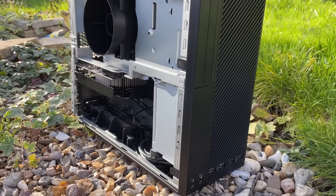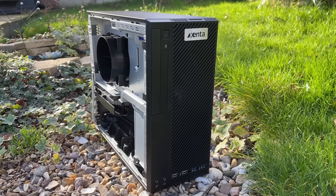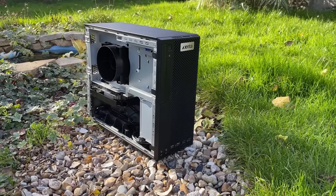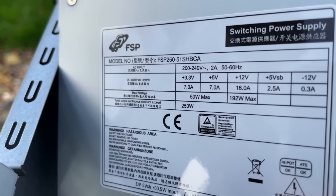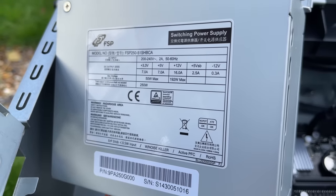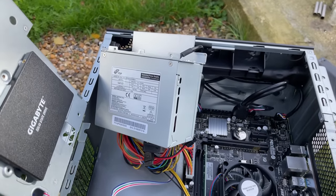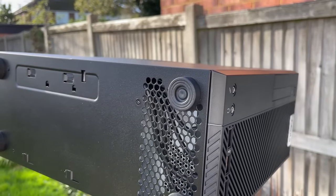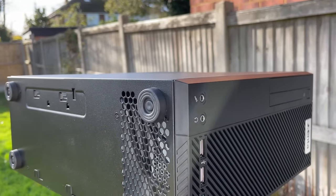Fast forward 20 minutes and our A6 had been replaced with the Ryzen 3. The 8GB of RAM was now 16GB, and the 1050 Ti was just about inside the case — very close indeed, but luckily it's a very cool and quiet card that should work fine in this small enclosure. We're running all this on the included 250W power supply. I wasn't sure about this, but the 1050 Ti doesn't require any external power and the Ryzen sips power itself. The lid closes as well, which is always handy.